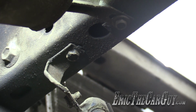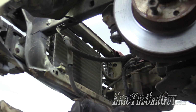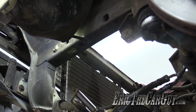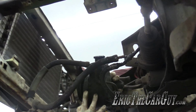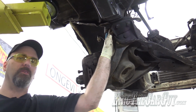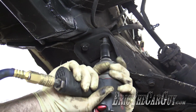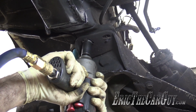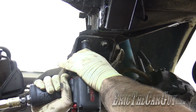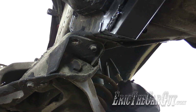There's only one fastener holding this power steering pump on. The way it's hanging is kind of jank. I'm just gonna knock that fastener loose and flop everything up over onto the K-member. Like that. Most of the weight is supported in the center above where the spring was, so I'm gonna loosen these fasteners out before I get my support. I think somebody didn't care when they put that in at the factory.